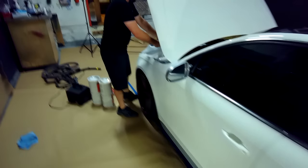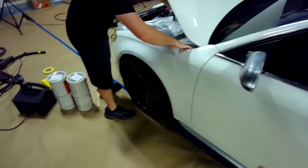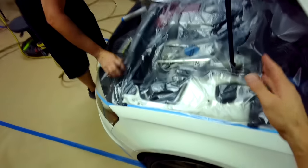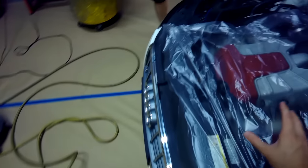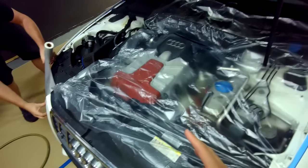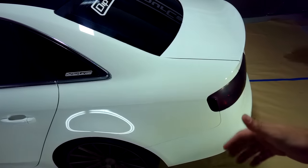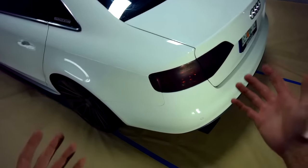I'm here with Gabe, our retail and shop manager, who normally does the majority of the masking on our cars. Gabe's already got tape and drape and he's going to start masking off the inside of the engine bay — you don't want any overspray making its way in there. Here's how it works: the more attention you put into the masking, the less time you have to put into cleanup when it's time to peel. If you put the time and energy into masking the car properly, overspray won't get in between panels or into areas you don't want it. When it's time to peel the car, there'll be very little to clean up.